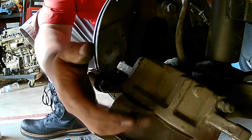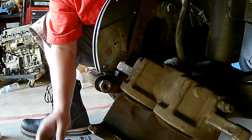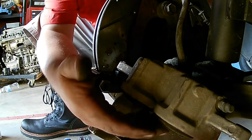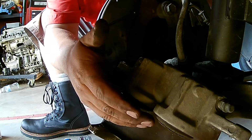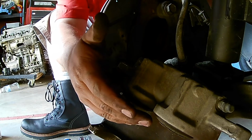You get a C-clamp, go ahead, push them back in slowly. I'll put some links in the description below. Eric the car guy has a video of him doing one, but you just push the caliper pistons in nice and slow. And then after you're done, check your brake fluid reservoir up top, make sure that's full and at the right level.